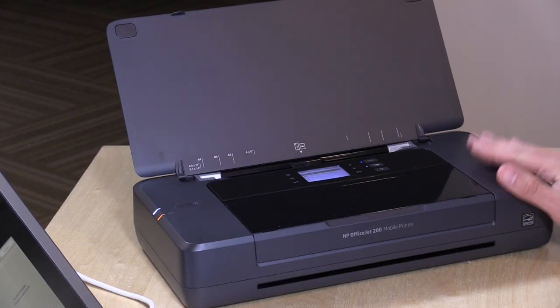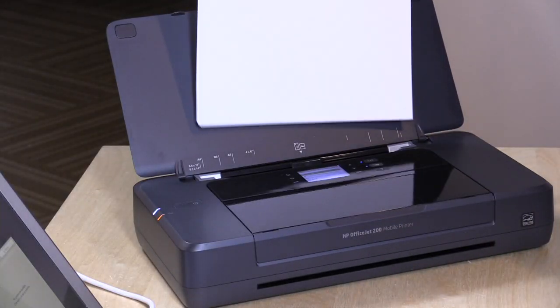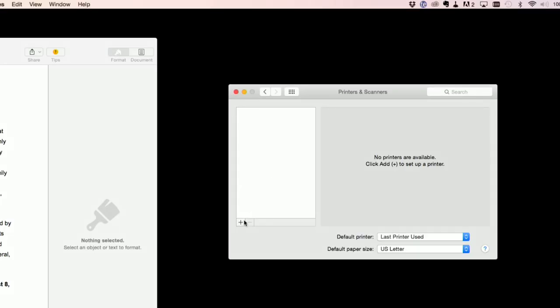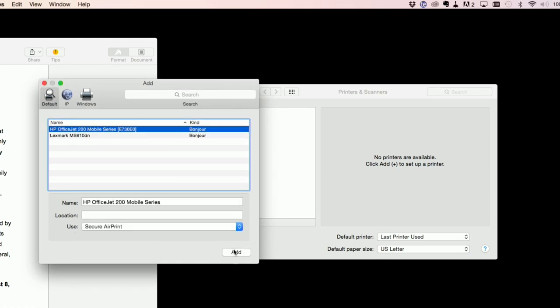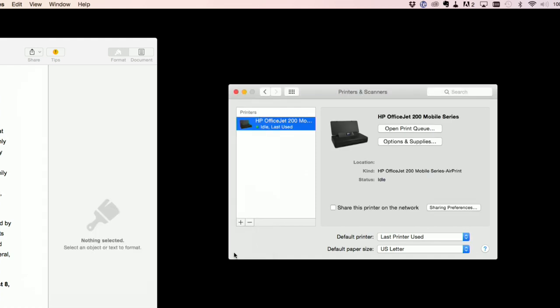Let's look at configuring the printer on the Mac — the process is very similar for Windows too. I recommend rebooting the printer by turning it off and back on after any configuration change; it just seems to work better. I'm going to load some paper in now because we're almost ready to start printing. Switching over to the Mac, when I click the plus icon to add a printer, you'll see it found it on my network. The computer — whether Mac or Windows — needs to download drivers, and it does that automatically. If we were just directly connected to the printer on the road, we can't get on the Internet, so you want to get everything set up when you have Internet access available, so drivers are already installed when you're out in the field.